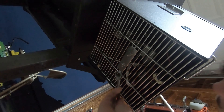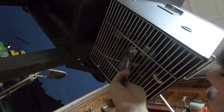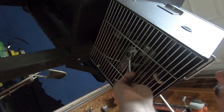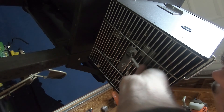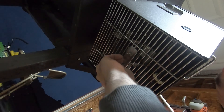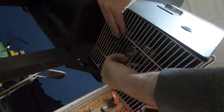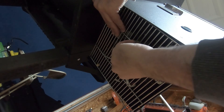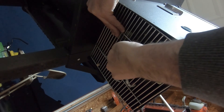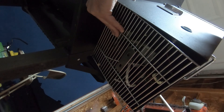Now we're looking underneath the pellet hopper. We see there's a grate to keep you from putting your hands in there and getting your fingers cut off by the fan. Simple enough to remove this grate — it's two 10-millimeter bolts, use a socket wrench or nut driver, whatever you have. It's just a bolt and a lock washer. Righty-tighty, lefty-loosey. They should come off pretty easy. Once they're off, the grate just falls off, so I'm holding pressure here to catch it and move it out of the way.